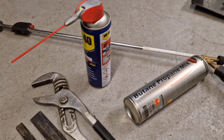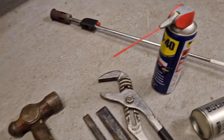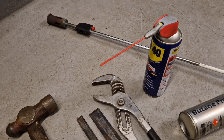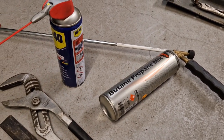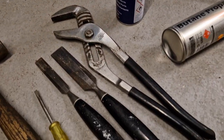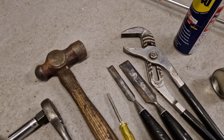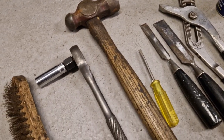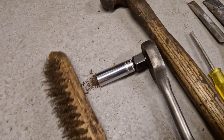These are all the tools I used: some WD-40, the weed burner for warming things up — though it's a bit rough and ready for this job; a plumber's torch would give more heat. A set of eagle beaks for prying the exhaust hangers off. I ended up using a small chisel to gently knock between the two exhausts and spread them apart, a screwdriver for starting off the hangers, and my trusty Snap-on 15mm socket with a decent half-inch ratchet with converter, and a wire brush.